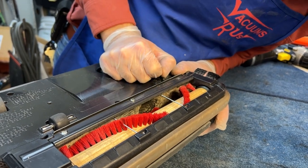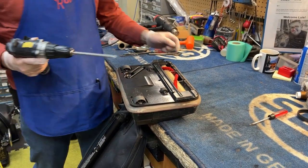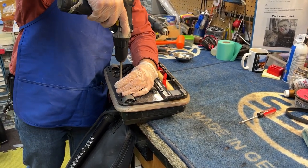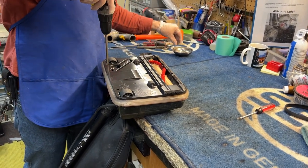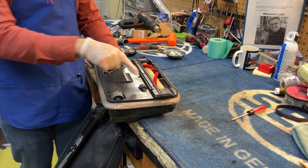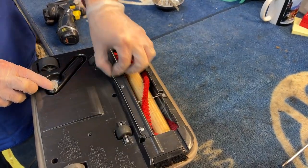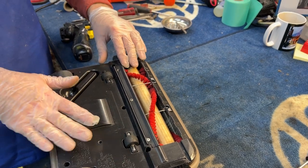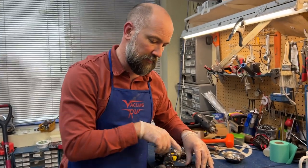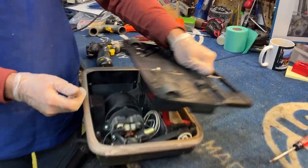Other times maybe not. So I'll take off the base plate — I believe it's five screws here, and this is actually a super easy task to do. One, two, three, four, five. Now on XL-style vacuum cleaners there are three screws right here which hold in your squeegee. We only have two screws — this customer was very helpful and started removing screws before they brought it in. Don't do that. So it is missing a screw. You take out screws one, two, three, four, five, and then this plate will pop right out.